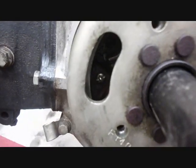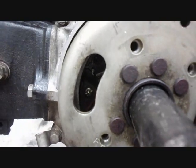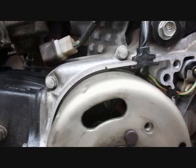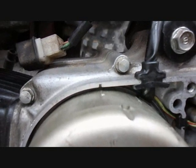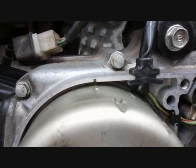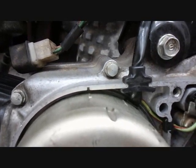There's a little place you can put a screwdriver to adjust the points. What you want to do is adjust the points so that when you're going counterclockwise, just as the F comes by, the points just begin to open. You can eyeball it but my eyes aren't that good — I like to use a meter so I can see when it electrically opens.